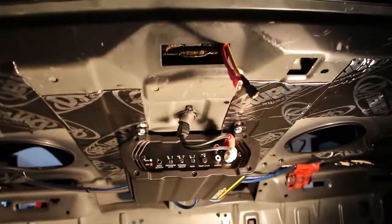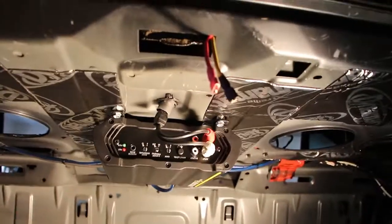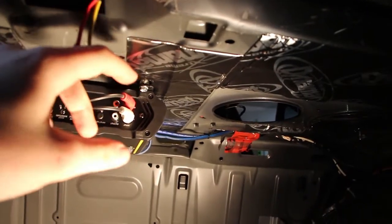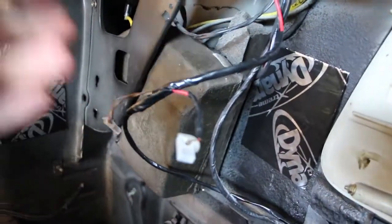Since having one trunk light on the side doesn't really illuminate the trunk all that well, and there's a cutout in the sheet metal, I figured just add another one. So I made a little wiring harness to prepare it. The harness goes up on the hatch shelf where it's taped down, comes out through here, and this little red wire is the power supply — I tap it into the harness here, soldered into the wiring. The ground just pops down and grounds down here.